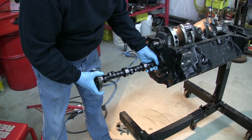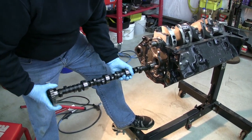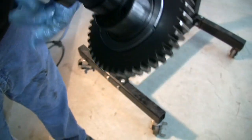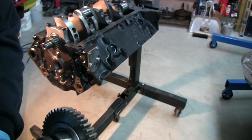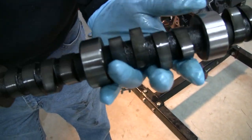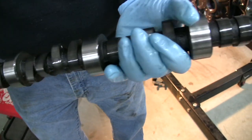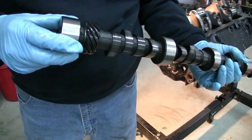We're going to pull out the camshaft and take a look at it. I see some kind of thrust washer, roller washer on the back side of the gear. We'll take a closer look at it. Actually, the camshaft looks to be in really good condition. Had some good assembly lube. I don't see any kind of wear or tear anywhere on this. Anybody want a bump stick? Here it is - we're not going to use it. Alright, let's keep on going.